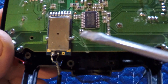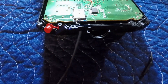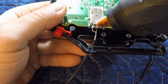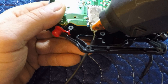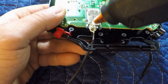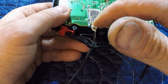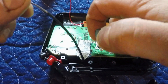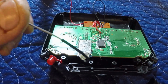Soldering is done — we've got our negative and positive. Now it's time to encase them with some hot glue, making sure the positive and negative leads stay separate so there'll be no issues. Start by encasing that to make sure the solder doesn't let go. Don't be shy with the glue — you can always remove it if needed, but make sure you have a solid joint. Now that we've got hot glue over the solder point, I've run the shrink tube down and put a little heat to it — this helps keep the ground wire away from anything and keeps the wire protected.